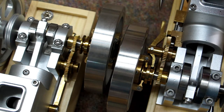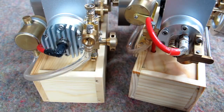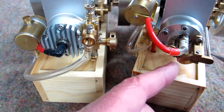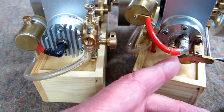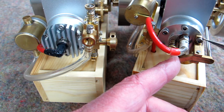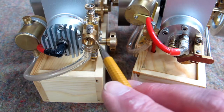All of this has been eliminated and replaced by this single rocker arm. On the M90, if you take out these two head bolts and this support for this rocker arm, there's no indexing pin or alignment pins for that, and that thing is free to move. When you go to put this back on, trying to get everything aligned so it hits the top of the exhaust valve correctly is a little bit tedious. It can be a bit of a problem for someone who hasn't worked on model engines much. This makes life simpler.